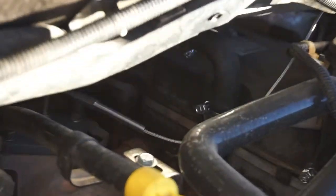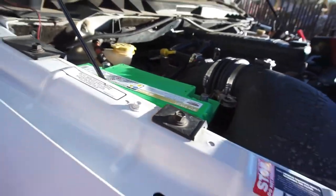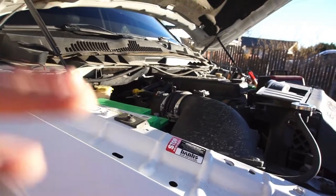I'm running into issues on the truck. If you watch my last video I go into what I did. This hose right back in there goes to the heater core — it's hard to see. You can see there's a lot of wet leaking coolant back in there. That hose going to the heater core was leaking, so I fixed it, it stopped leaking, not leaking anymore, and I hosed off the whole engine.